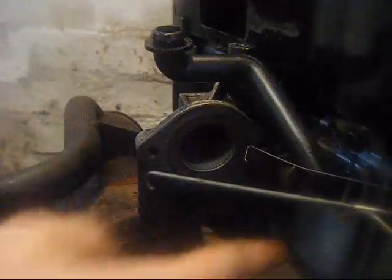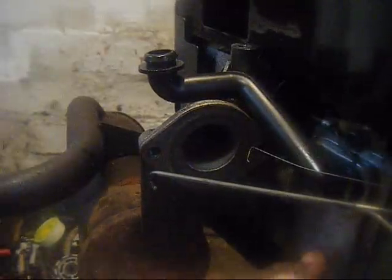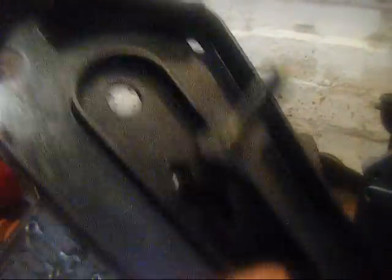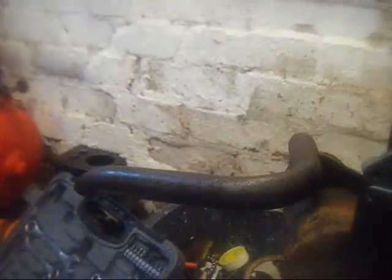You've got your intake manifold, push rod chamber, PCV tube, and in here there's actually a PCV valve — and this one has got stuck before. When I was overriding the speed governor with this little lever down here, the valve was stuck and it sucked oil through the tube, some of it went into the engine and the rest went out through this hole which is right above the exhaust. I thought the engine was a goner, but it's still running.